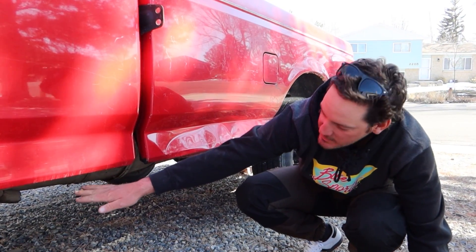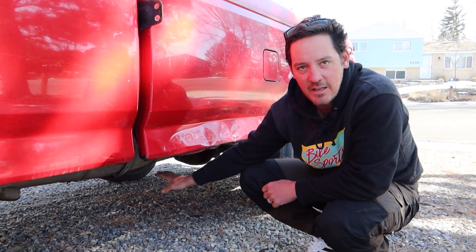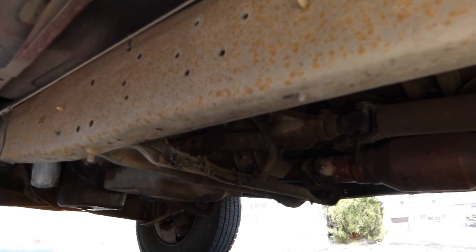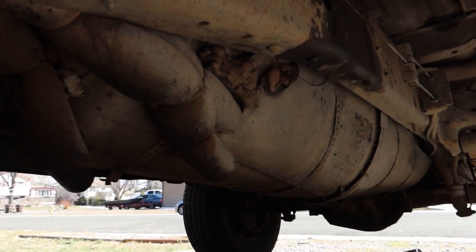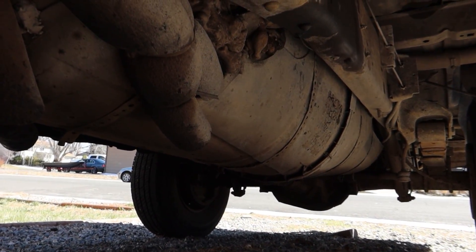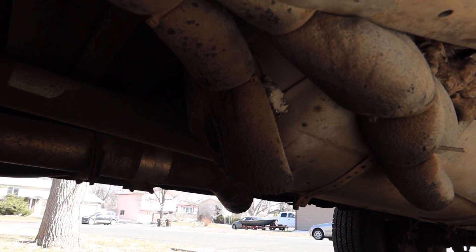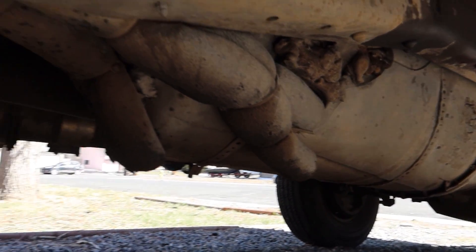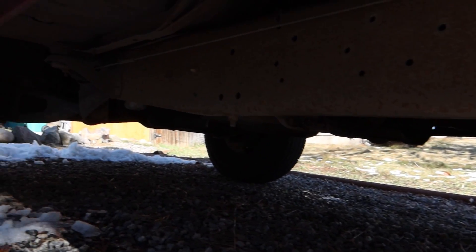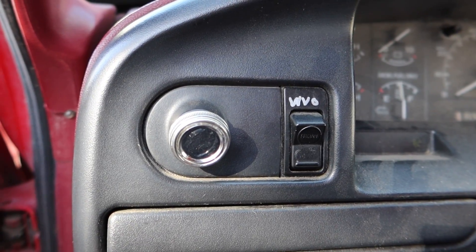So the coolant lines from the radiator come along the frame along the fuel lines, heating the fuel lines, and then into what looks like a trash can cut in half — it actually is a trash can cut in half — that is strapped to the tank and insulated. So once it gets hot, if I'm running errands I can turn it off and the tank won't get really cold quickly. It maintains heat and heats up the vegetable oil so that it's running through the system as close to diesel viscosity as possible.